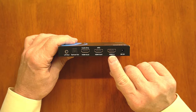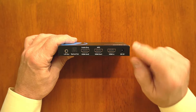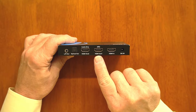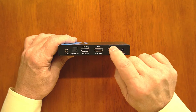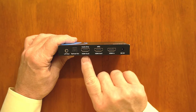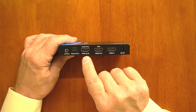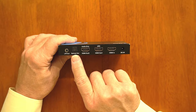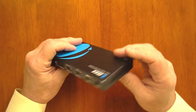To the left of that is the HDMI input port — you'll connect an HDMI cable from this to whatever source you want to decode audio for, such as a game console or cable box. To the left of that is the ARC HDMI output, which is your main output port that connects to your monitor or projector so you can view your source. It's a pass-through that lets you extract the audio simultaneously. These three connections to the left are the audio output connections: if your device supports HDMI audio out, connect it there — video won't pass through that port, only audio. Next is a digital optical out connection, and to the left of that are the left and right analog audio outputs.